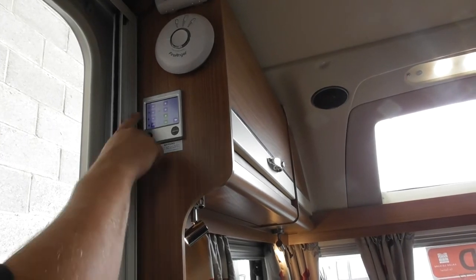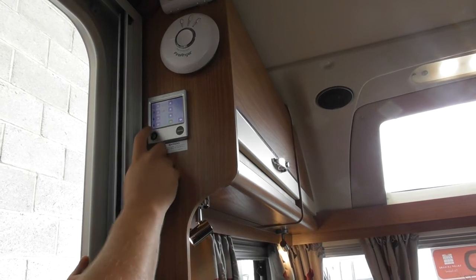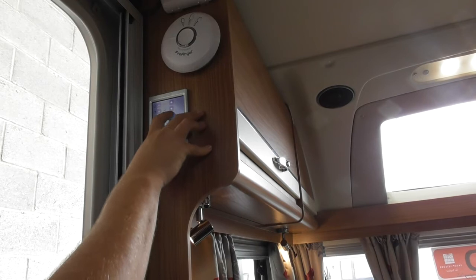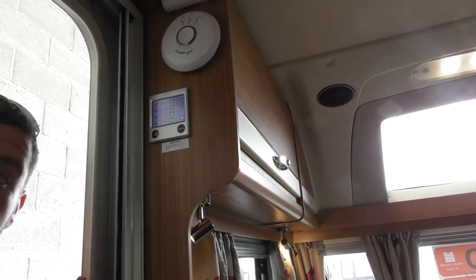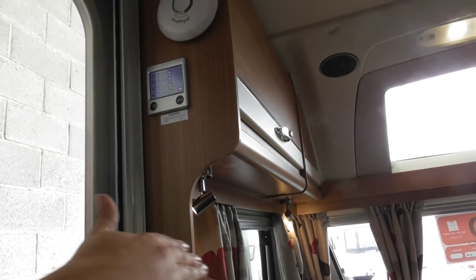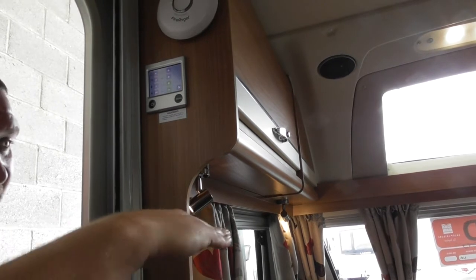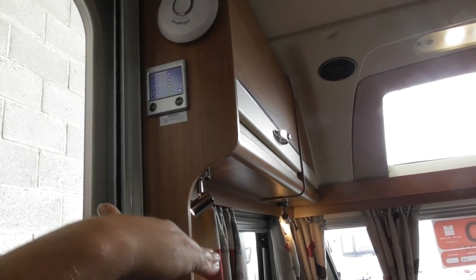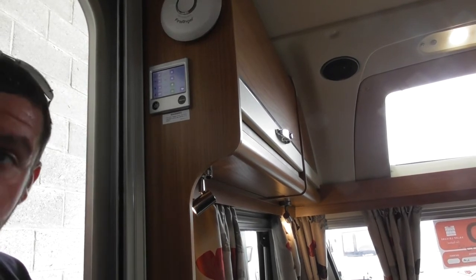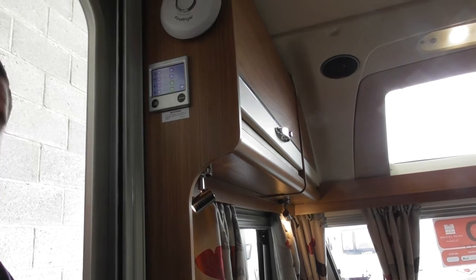Yeah. Excellent. Now, the bottom two are your power selects. So, electric: that's electric off, or it will run on 1 kilowatt, 2 kilowatts, or 3 kilowatts. The easiest way of describing that is to think of an old Granny's 3-bar fire. So 1 kilowatt is 1 element, 2 kilowatts is 2 elements, and 3 kilowatts is 3 elements. All it is, the more power you send to the unit, the faster everything will heat up for you. Okay? Happy with that? Yeah.